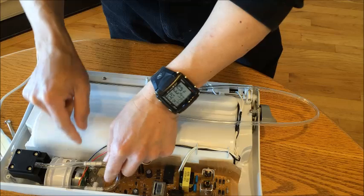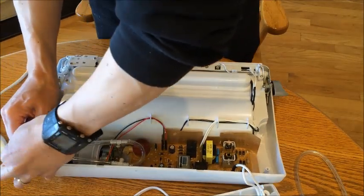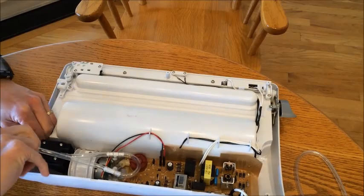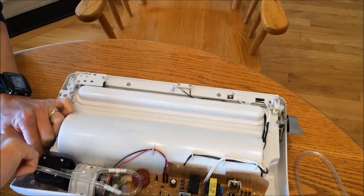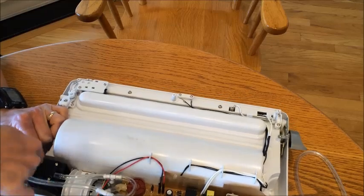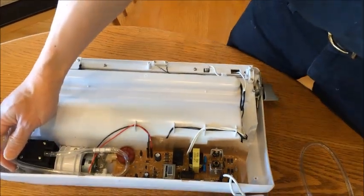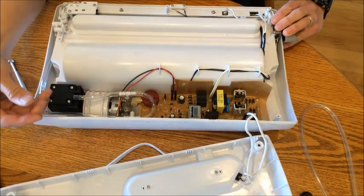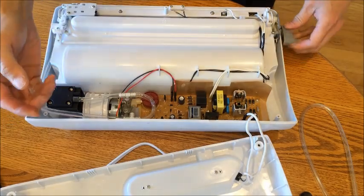So now I'm going to work my way down here to figure out where the problem is. It's probably not with the sensor there, although that's possible. There's a T here. Let me try disconnecting at this point. When trying to disconnect these hoses, what you want to do is twist — that will break the seal and make it a lot easier to get pieces of tubing out. So I got this free. Let me now turn on and block this up to see if we get better results. That actually works, so the problem is after this point.